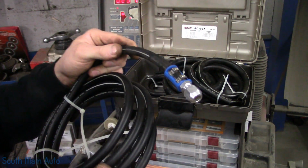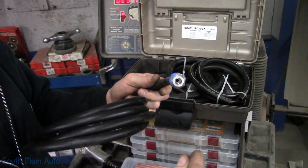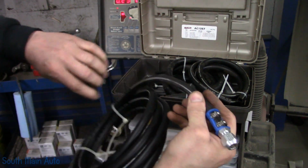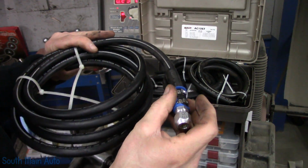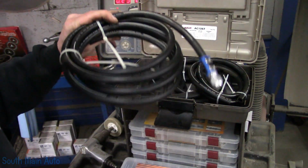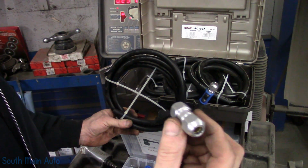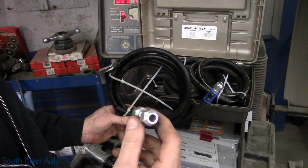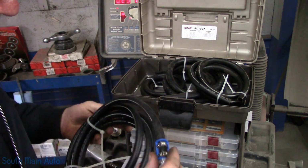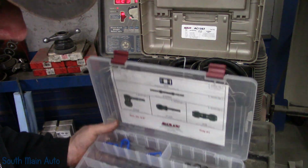And what my intention is, when we go under there, hook this back in behind the fuel tank. We're going to cut the line, pull it down where we can work on it, slip this little guy on, crank her down. Going to run ourselves probably a 12-inch section, put another one of these ends on, and hook it up on the flat spot in the vehicle where it's more accessible. And that is all assuming that I am correct and I do not have enough room to efficiently put one of these on without using crow's feet and getting all silly with it. That is my plan.